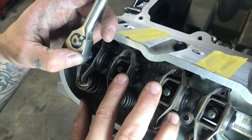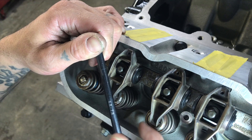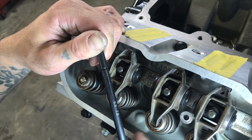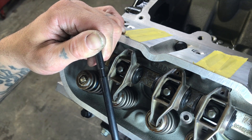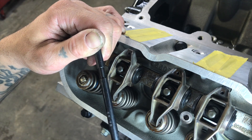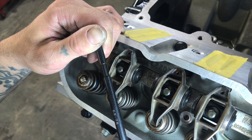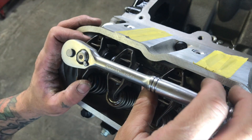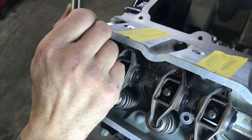So let's go to our measurement from the first test, which was 7.3875. Setting that up carefully — 6.8 plus the turns to reach 7.3875 — and counting the turns after torquing to zero lash: a little over half, not quite three quarters. That's within range. So we've found our range as far as pushrod length goes.